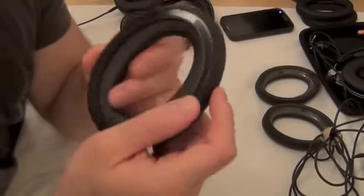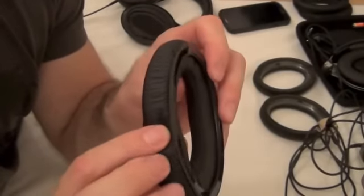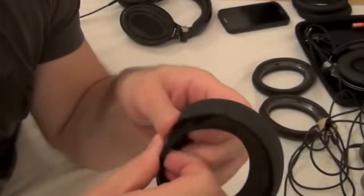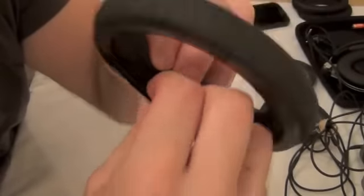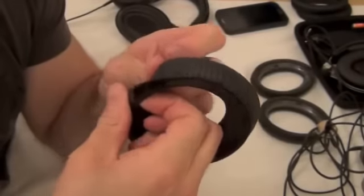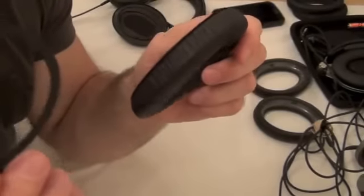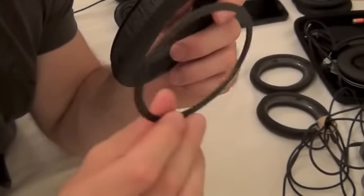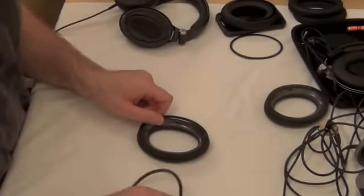Now what you need to do is look at the back here. What you see is you have the rim which is attached to the actual ear pad. We're interested in what's underneath that rim — underneath that rim is what we call a lock ring. As you can see, I'm pulling this out. So that fits right under there, and we're going to take the lock ring out just like that. The lock ring is what you need to take out of your old ear pads and put into the new Head Foamate ones you bought, because we do not supply these.